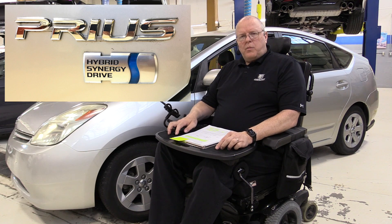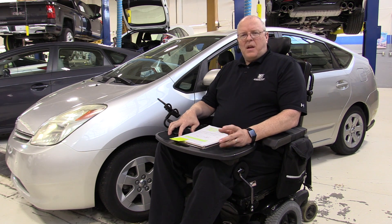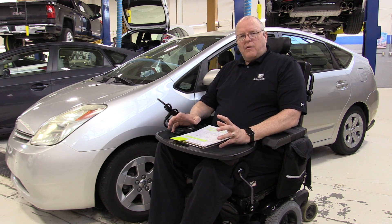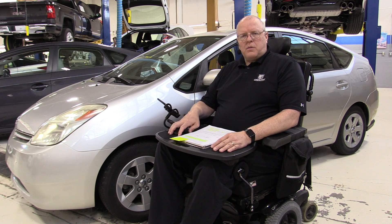They made great improvements in the inverter converter assembly, made changes in the battery, and made significant changes in the transaxle that increased the power of the transaxle. The engine power is pretty much the same as before — it's the same engine. They made some small adjustments to the variable valve timing, but other than that it was the same engine. So the majority of the changes that made the improvements in the second generation Prius were due to the control of the transaxle, and the transaxle in this car is the P112 hybrid electric transaxle.